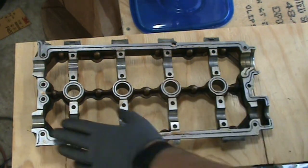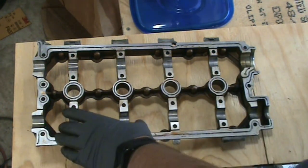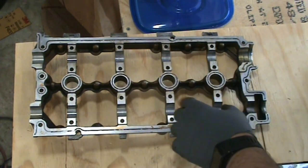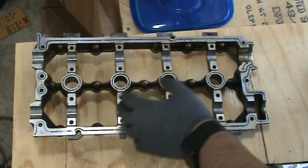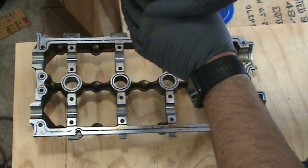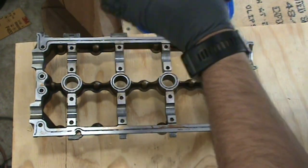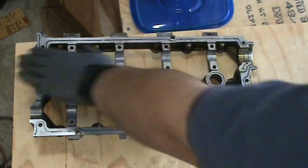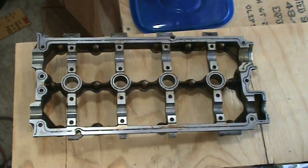And normally a valve cover gasket or a gasket up here in this area wouldn't need super oil resistance necessarily, but I'm a little bit concerned that this motor sits at a slight angle and oil likes to collect on this low side and it eats through or ate through the original material and caused a leak, and I don't want that repeated. So the whole goal here is to make it better than what it started out as.